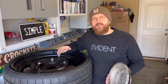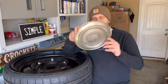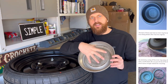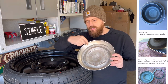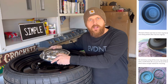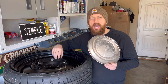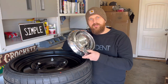If you're watching this video and you're wondering if the hubcaps you currently have fit on this, what I would do first is measure. This is what these caps were made for. Some of the hubcaps that you may have, on the backside, it may curve in and be smaller on the inside. There is a fix for that. As you see on the picture on the screen, you can cut out around the edge of that hubcap and make it the same as a dog dish, and then install it directly on the wheel. If you're running anything smaller than a 10 1/4 like a dog dish is, then this cap clip's not going to work for you. I don't have a template for that yet. I'm looking into options for that, but right now, all we can do is this type of hubcaps.